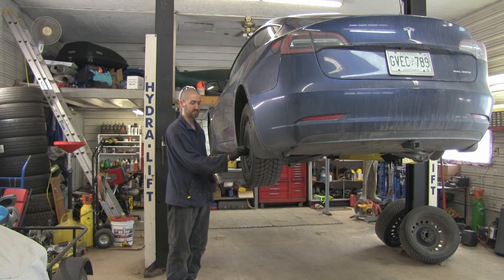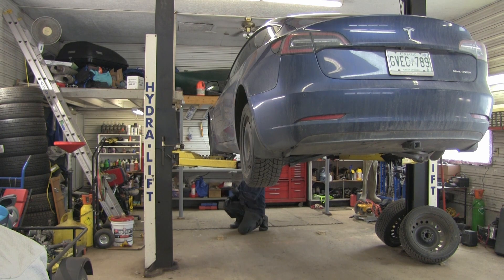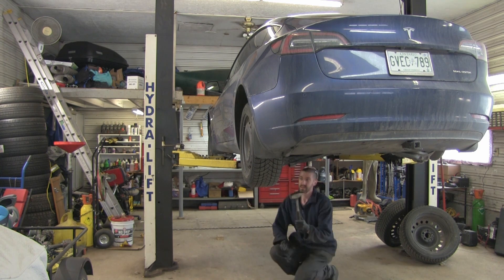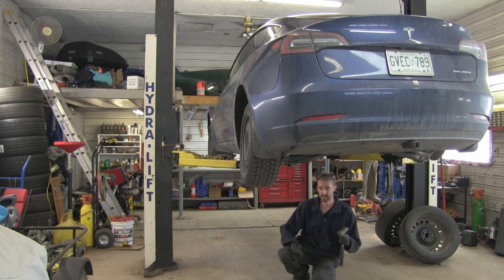This one's also stuck, so we're just going to leave one lug nut on there so we can hit it off. And another one over here as well. So once again, we just come up to the backside of the tire. Only hit the rubber. Comes right off. And same with back here — only hit the rubber on the tires.